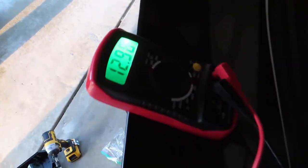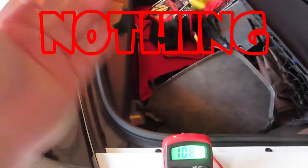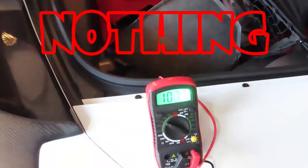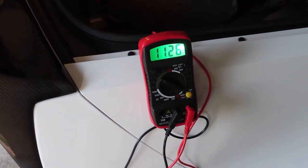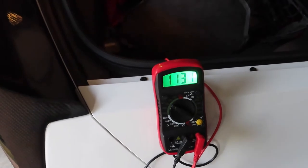The battery is hooked up and reads 12.95 volts. It will not hold charge even with the ultimate battery charger at 100% condition — this battery just won't hold. It didn't crank with enough power. It dropped to 10 volts, now it's at 11 volts. It's not enough cranking power — even with all accessories off, we have a hard time starting the engine.